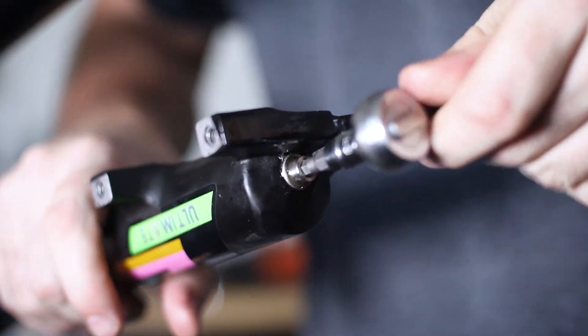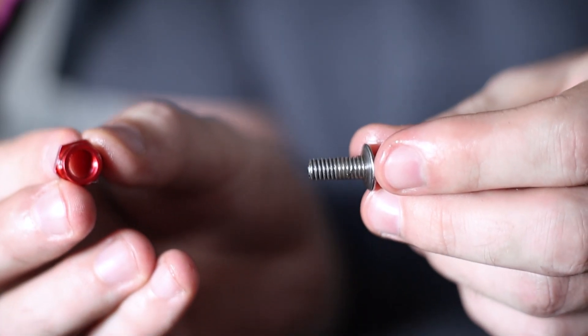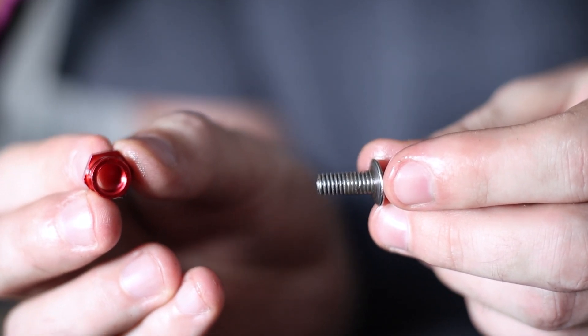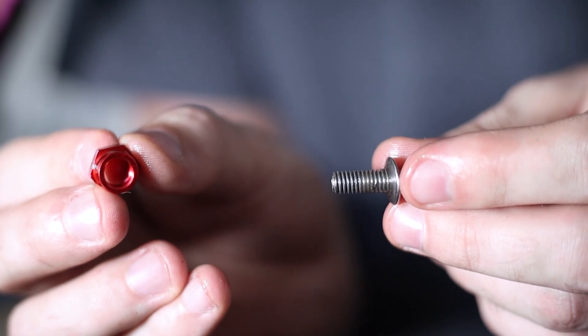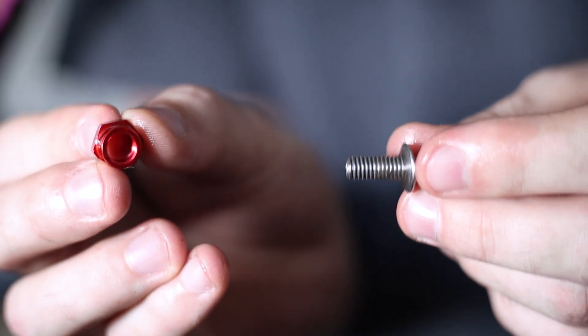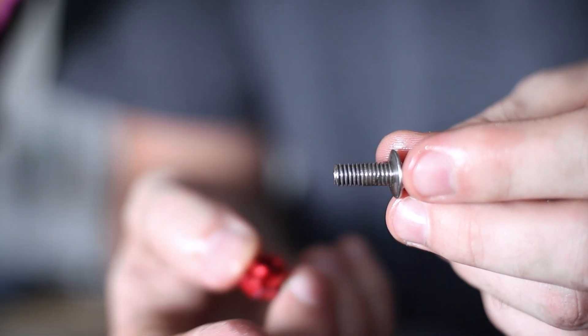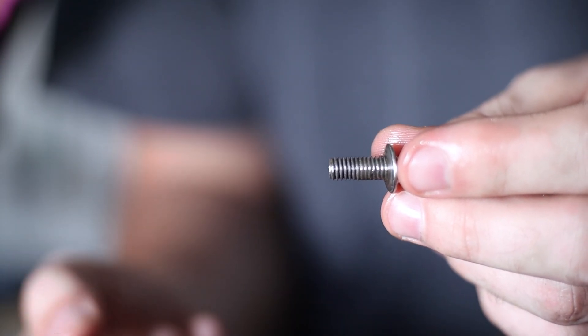This side is the air shaft and there's just one little allen bolt here. So this nut for the damper and this bolt for the air shaft are the only two things holding in the entire lower part of the fork — and the lower part of the fork is what holds on your front wheel. So this thing could easily break off. Now I know exactly why this fork says 'warning: do not use for downhill or freeride.'